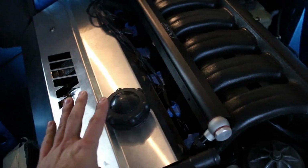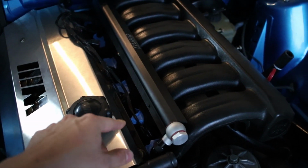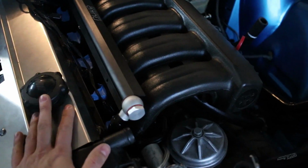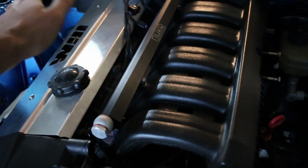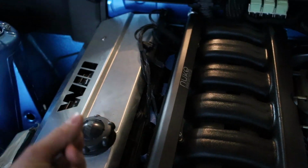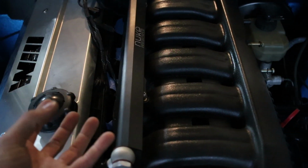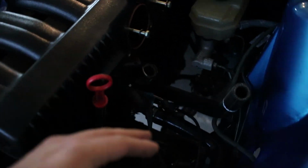The exhaust isn't done. Whenever I'm ready to start, gas is in the car, oil's in the engine, I will put the injectors in, and then we're just good to go. I'll leave them off just so they're not exposed to the elements. You want them submerged in fuel or sealed off from the humidity as long as you can. They're very sensitive like that.